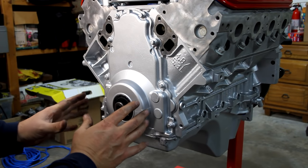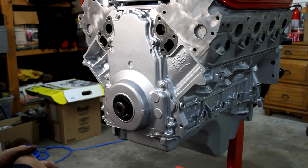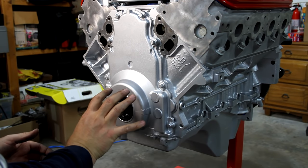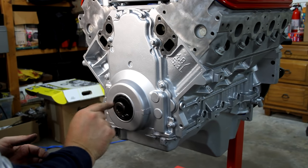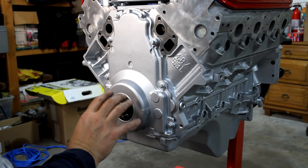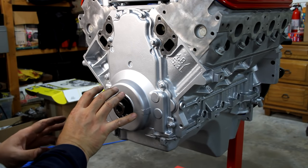Okay, during the painting, you may have noticed that I took off the balancer, and I did that solely to make it easier to paint this stuff up, and I didn't actually have it all the way installed originally. I went deep enough to make sure this rubber gasket was centered on this crankshaft. So I ended up pulling it back off, and now to actually reinstall it and get it torqued